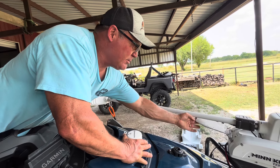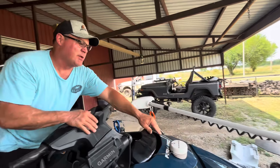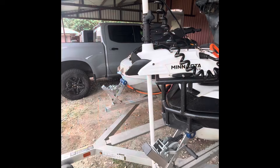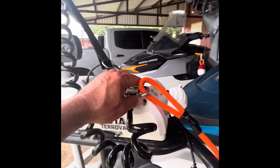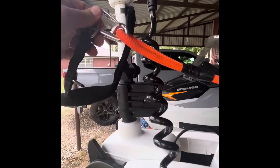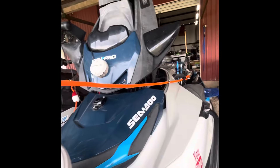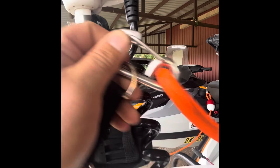For the most part, it does exactly what it's supposed to — it'll push down, you can move the trolling motor ahead and it'll let down, and then you can push it down to release and bring it back in. I've got a second way with just a rod that'll show you how to do that. You can do it with a plate, but again, probably aluminum so you don't add any weight to where that spring can lift it back up.